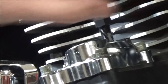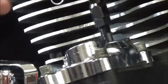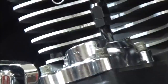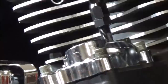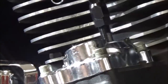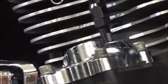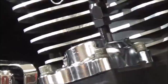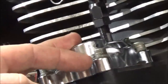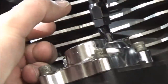They do not give a torque spec on that, so just tight — lock the lock nut against the adjuster. I'm going to duplicate the process on this one. I see I can't rotate this right now — because what just happened? I opened it, so I pushed that down and the lifter said no, it got some oil in here and locked up. My rod, as I lengthened it, opened the valve spring, opened the valve, and set it where the valve is at top dead center — so that valve was being aimed towards that cutout or relief.